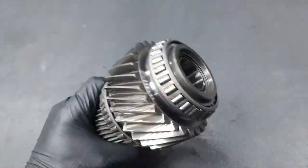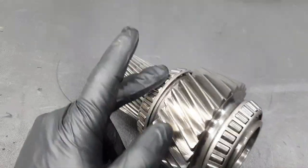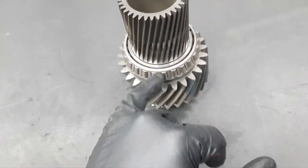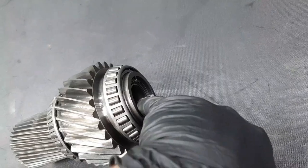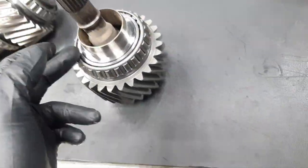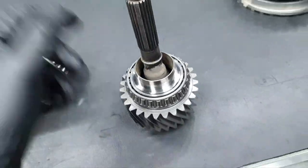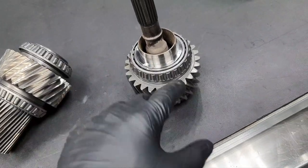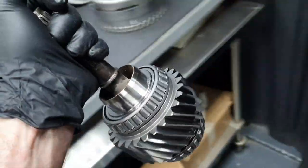Let's see these two gears. The inner bearing here, there is no problem. Outer and the gear itself, excellent. I have seen catastrophic failure of the bearings, and I have not seen catastrophic failure of the gears. And the inner bearing, I have never seen it fail. It's good. And the same thing here, both bearings are excellent. The cross doesn't move, it's fine. You're going to see the results if the cross inside here failed. The CV joint, I think, yeah. If this one failed, you're going to see the signs on the drive shaft. It's going to hit everywhere, and you're going to have a problem after that.